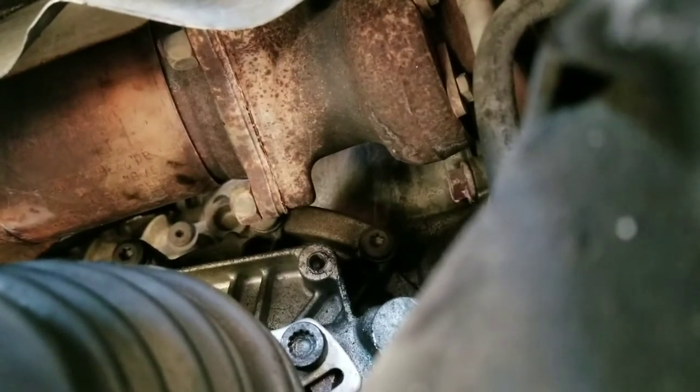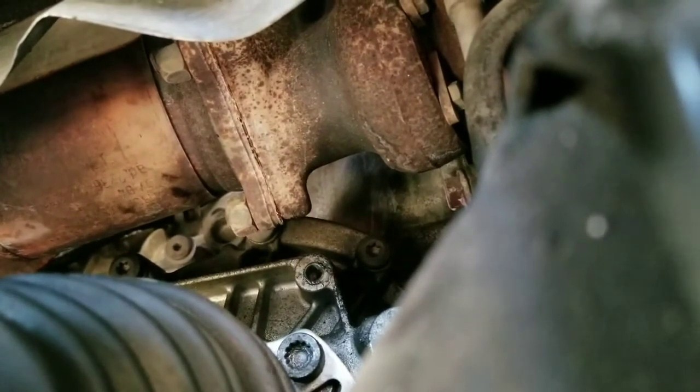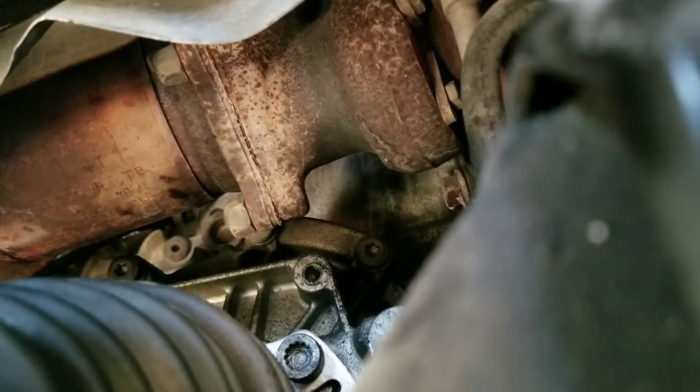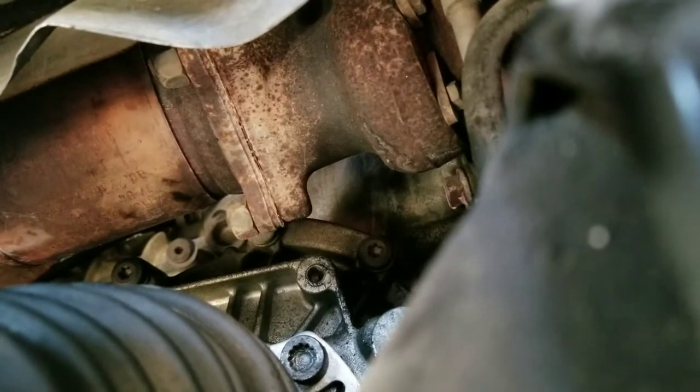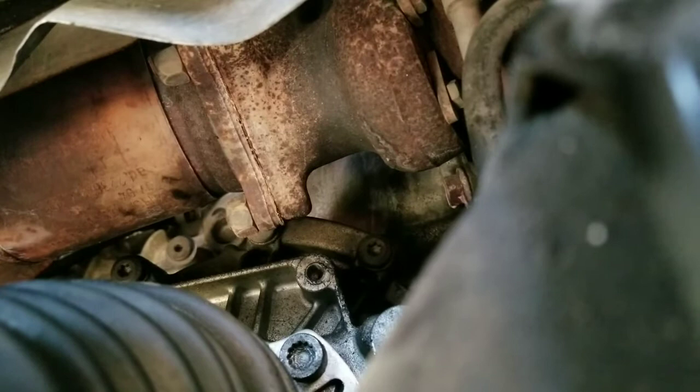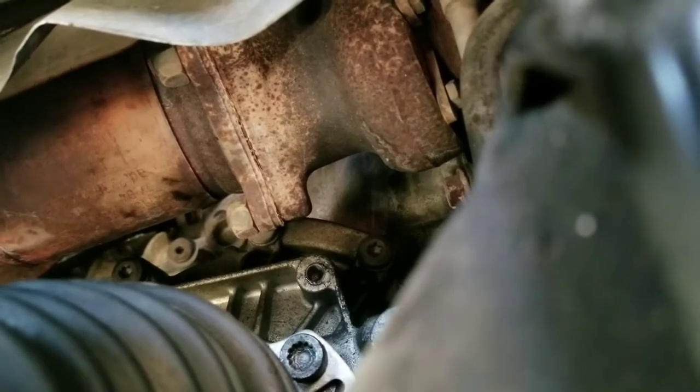One that went directly onto the head for the 17mm socket. Then I think it was a 6-inch extension, then another swivel bit. Then I had to reach my arm along the side of the firewall where the wheel well is to guide it onto the bolt. Then I could spin it.